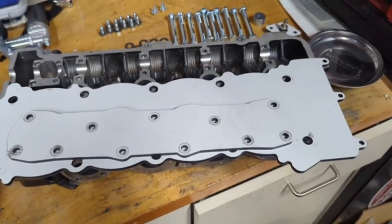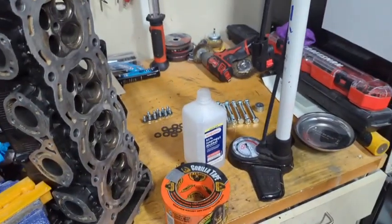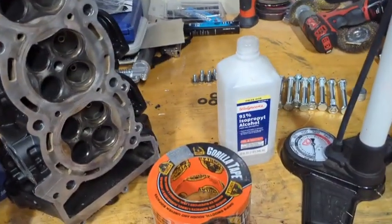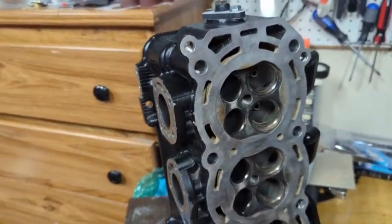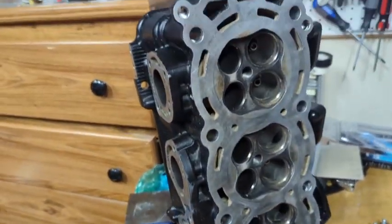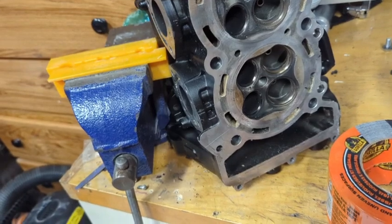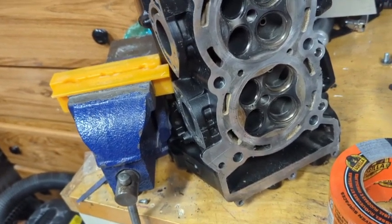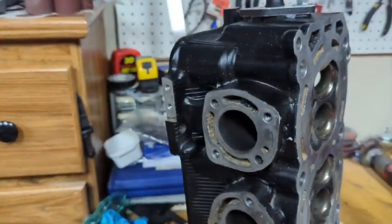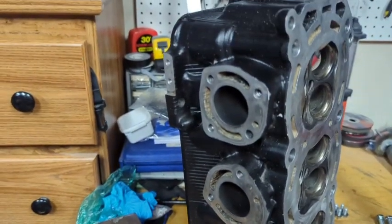The first thing you want to do is get the valve plate in place. You're going to want to have 91% isopropyl alcohol to clean the surfaces. The bottom area where the plate's going to go needs to be cleared of any oil. Go over that with 91% isopropyl alcohol and a clean rag, making sure there's nothing stuck on the bottom that would prevent a nice flat seal. The same holds true for your exhaust manifold area where the exhaust plate's going to go.